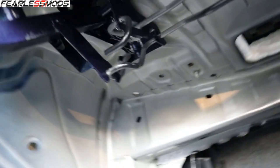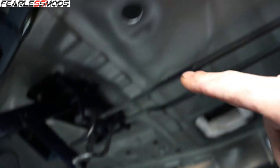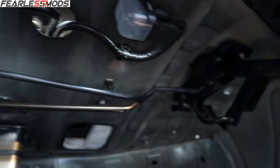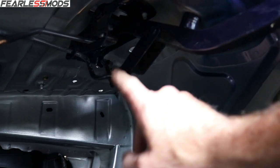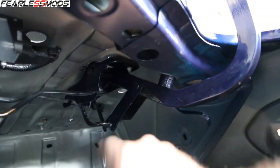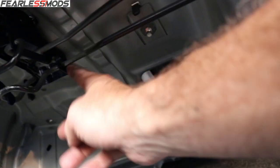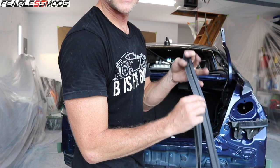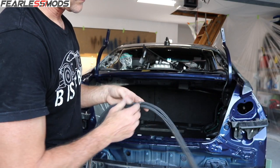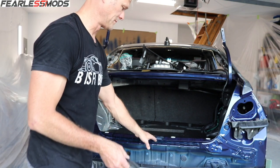There's the setup on the left. This is the right one — the S-curve goes into the flat here, comes across into the front groove, stays in front until over here, and then that's where it crisscrosses and goes back to the back, becoming the pushing point for this lever. Then this one — same kind of deal — goes into the slot, comes across underneath, goes through the back, and over into the slots here to come down and be the pusher rod. On this one there's a spot where it was split or bonded together to make a loop, and it has a little arrow on it — that's going to go right in the middle on the back.